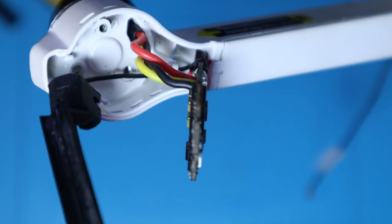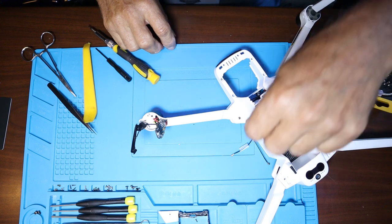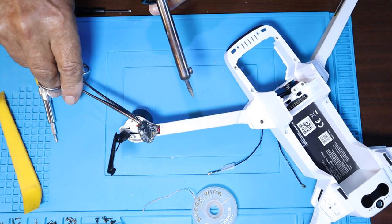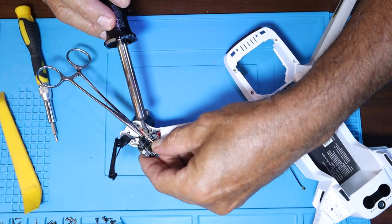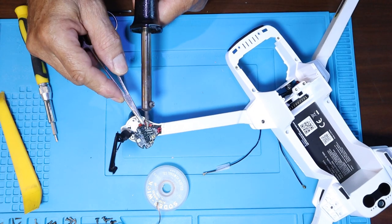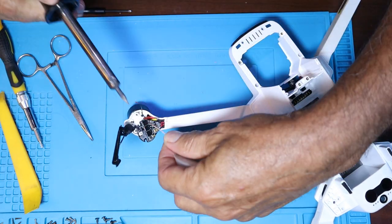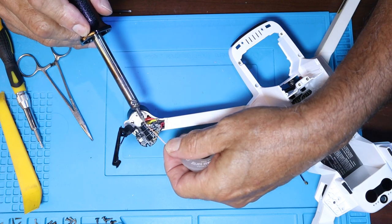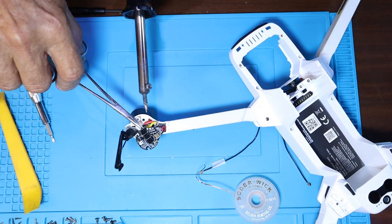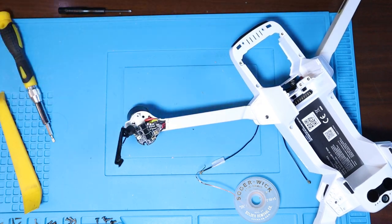The ESC probably sends a signal back to the main system board saying it's okay to proceed to the next test. Here's a really cool close-up of where the wires go — notice the yellow wire in the middle and the ground wires on top. I'm using solder wick — I burned my finger a little bit but I'm just using it to remove the solder from those joints so I can pull those wires out. Once they're out I'll take out some more solder because I'll need to put them back in.